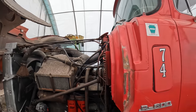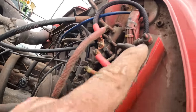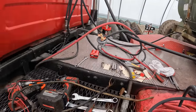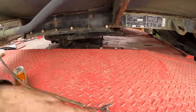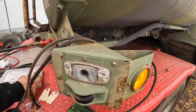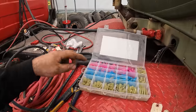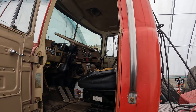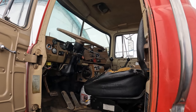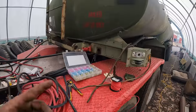It's part of having a truck that was manufactured in 1974. You get through this stuff — the wiring on this ain't nothing compared to a new truck. That pulls up, goes through this loop, and goes up here. I'd really like to find a two-wire section. This end is all chewed up too, so put some new ends on — I do have a box of them, we just need the wire. Heat shrink and all. I don't think my EGT gauge is bad at all — you can unplug it and reverse them right there. It's just not getting hot enough with the motor. So we'll leave that. We gotta get this wire.